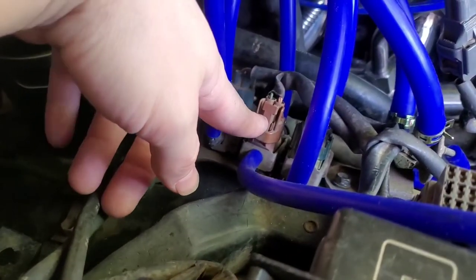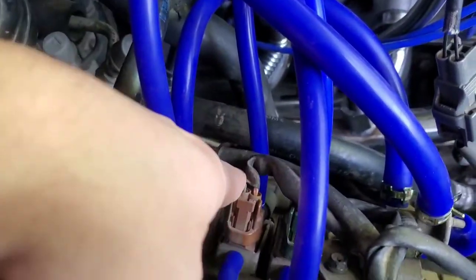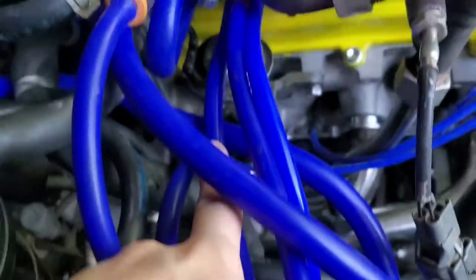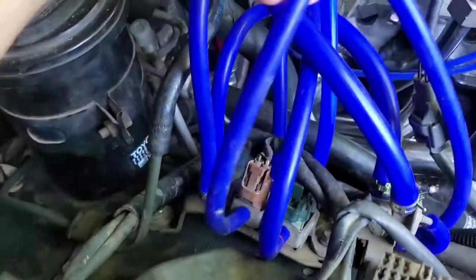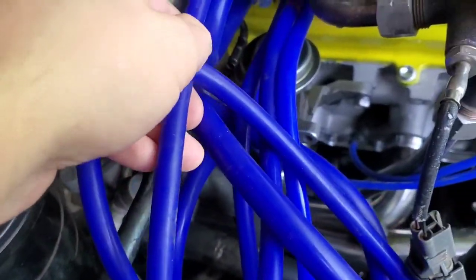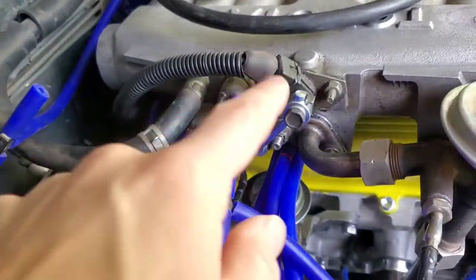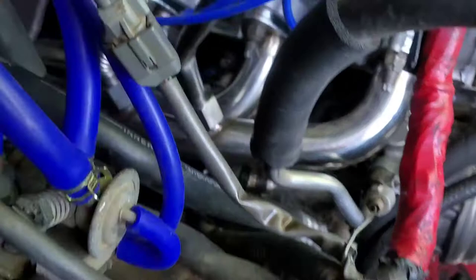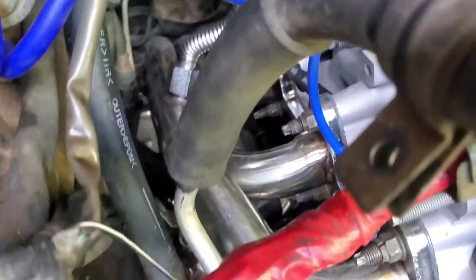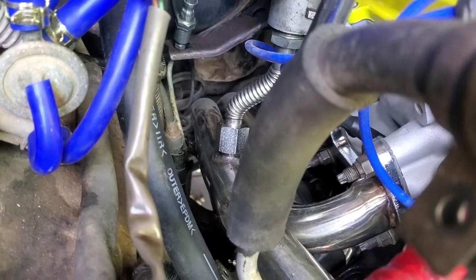As for your last vacuum switch valve — the red one in the middle — you have one hose coming from that bottom nipple right into the left of the two EGR connections, that bottom left one. Then the top one comes off and goes into your unmetered air at the top. So top to top. You're also going to have a little split there that goes off to your idle air check valve on the bottom right side.